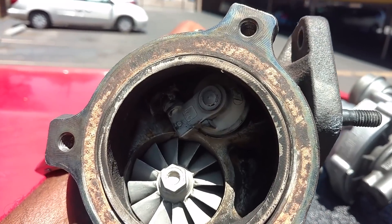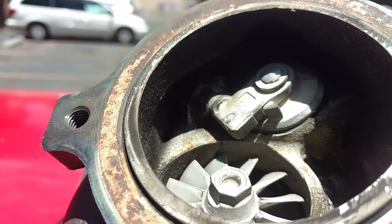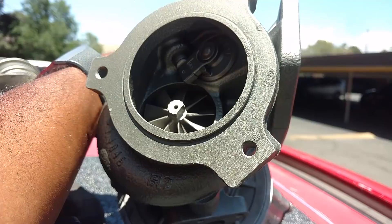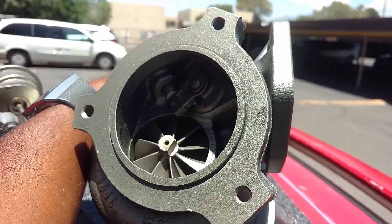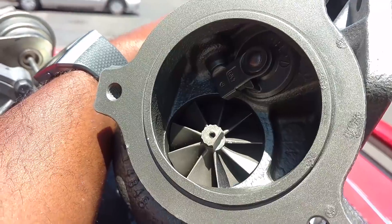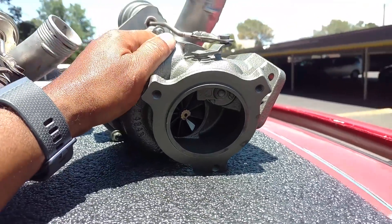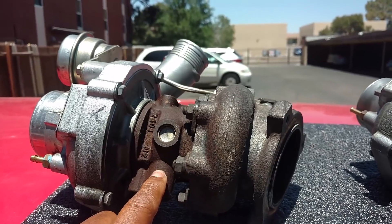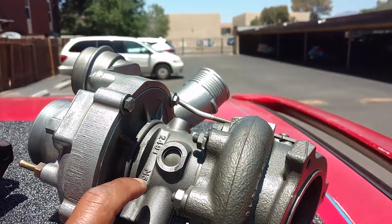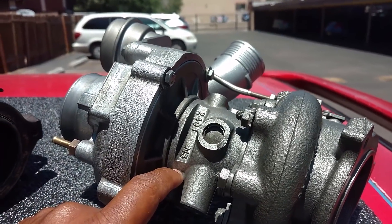From the factory, this thing came with a 12-blade exhaust turbine wheel. As you can see in there if you look closely, there's a crack in the exhaust housing — that's very common. But this turbine wheel has room for improvement. One upgrade made to this one is that it now has a nine-blade titanium turbine wheel. This wheel resists back pressure and allows the turbo to spool up faster, which means less turbo lag. The rebuilt turbo also has an improved thrust bearing that allows it to spool up faster, get better lubrication, and likely last longer.